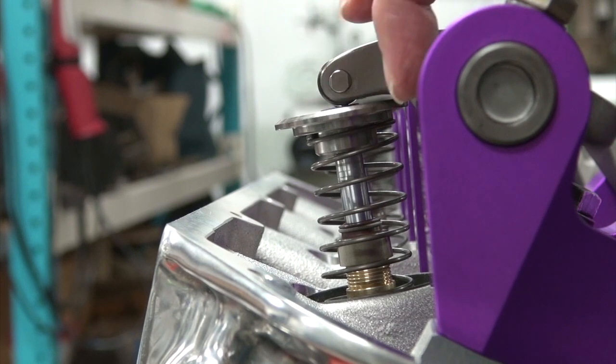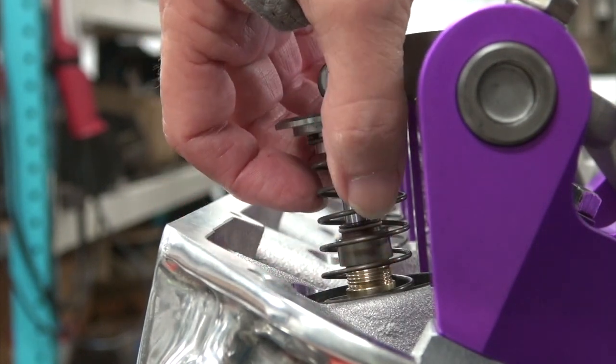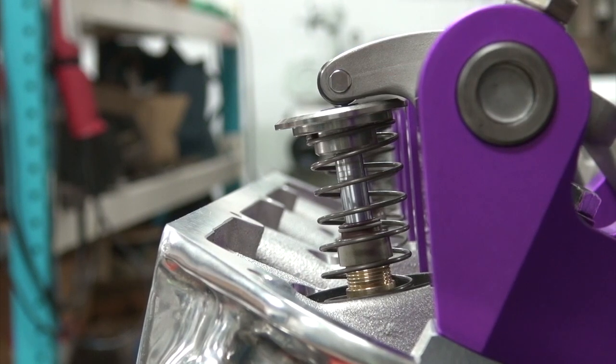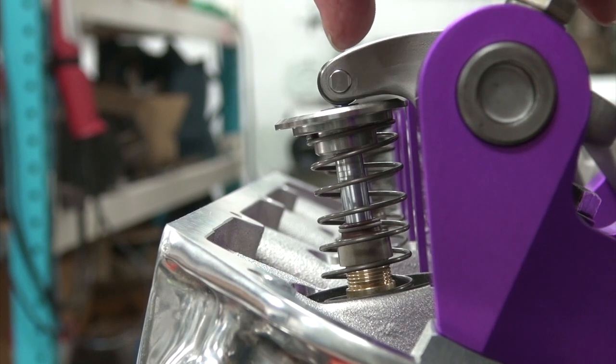The tip now is 200 thousandths and the lash cap is giving us 55, though it's really a little under 200. So if I had the same valves with the groove at a 250 tip, that would get me where I want to be. Remember this had too much spring height anyway, so that would also take that down some and I'd have to run less shims under the valves. Since we're using the stock type rocker setup, you can't really change your geometry.